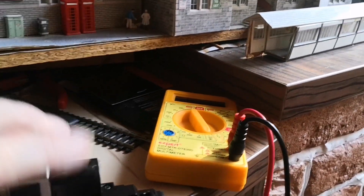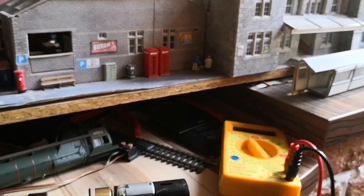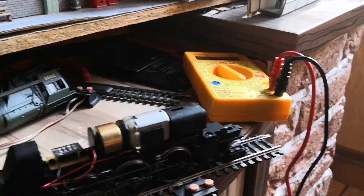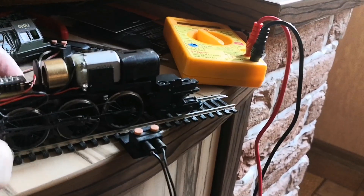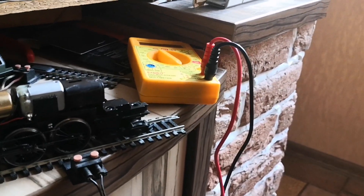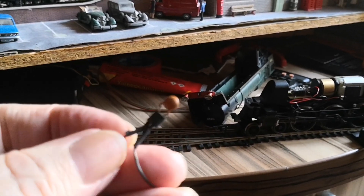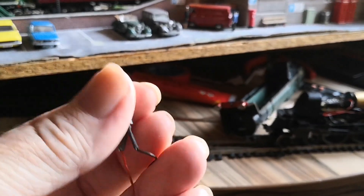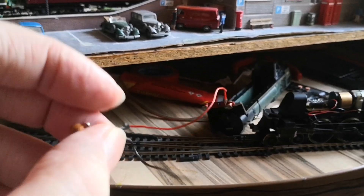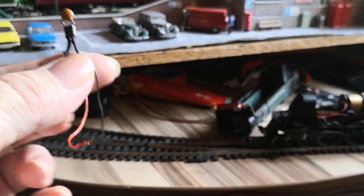Servicing the worm gear inside, maybe a little bit of silicone grease — I certainly wouldn't use anything else — and that would probably work. So that's all we've done to get this working. Now it didn't work before, there's no way it was going to move. So it's definitely down to this TV suppressor. I did test it and it's definitely no good — it just doesn't work, it doesn't want to pass electric. And the cable does look like it's overheated. So that will disappear into the bin after taking these two cables off, because I'm sure I can use those elsewhere.